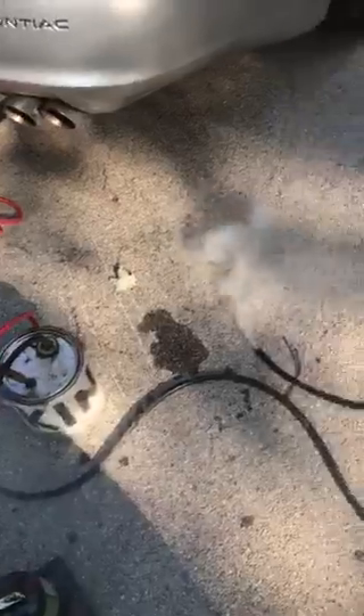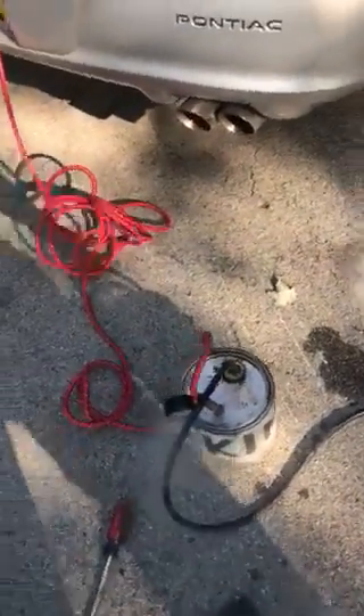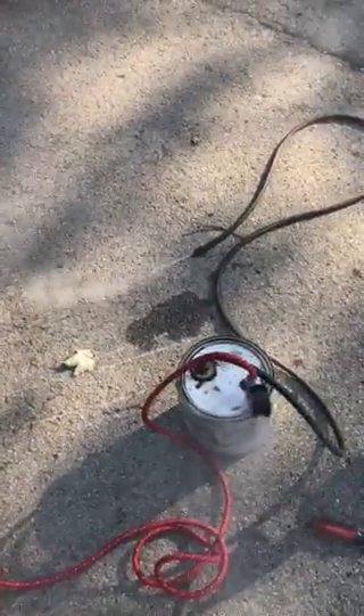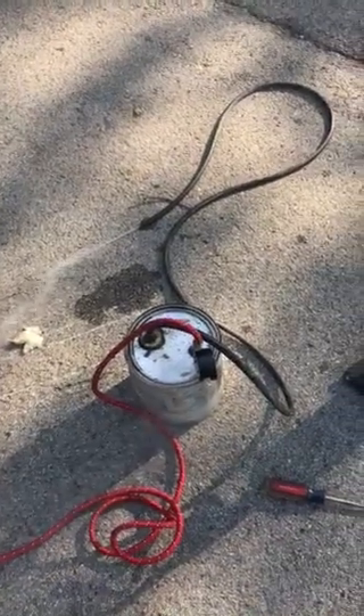You will find almost every intake air leak with that. And if you don't have the air on, it will stop smoking here because it will starve for air. That's it.